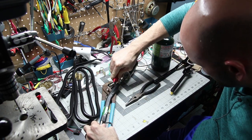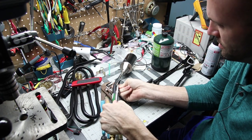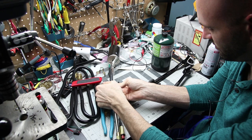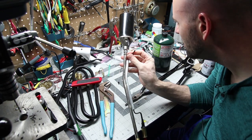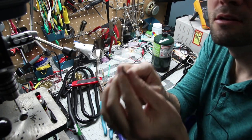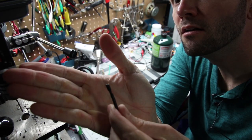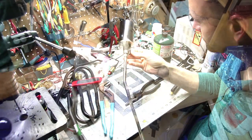So also the wire for that, guys, is held in with heat shrink. So I just peel that off. There's actually a little steel inner tube in there, I guess, that kind of separated the wires for that little barbecue pit clicker away from the pipe. I guess it might get a little bit hot. But the clicker uses just a regular kind of solderless crimp connector that slides on the end of that. So it's easy to pull off, easy to put back on.